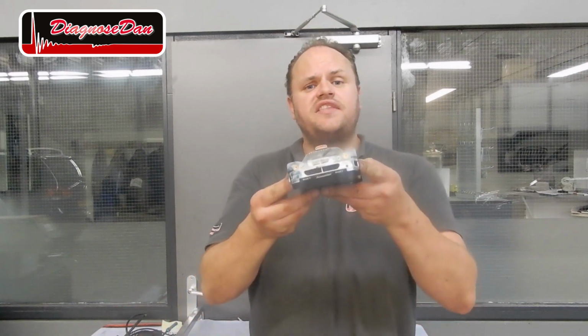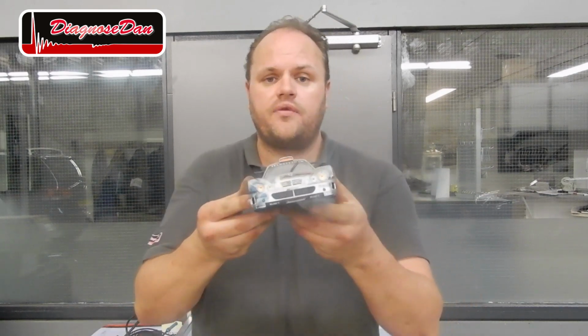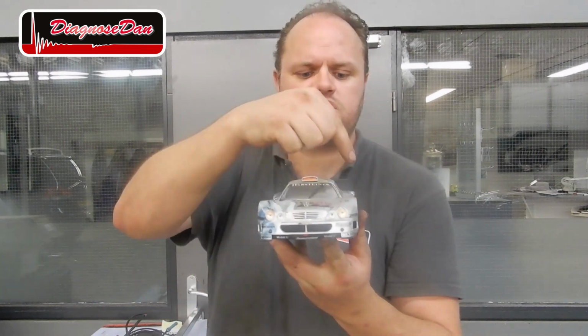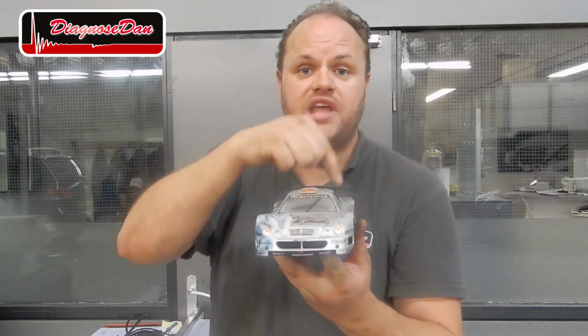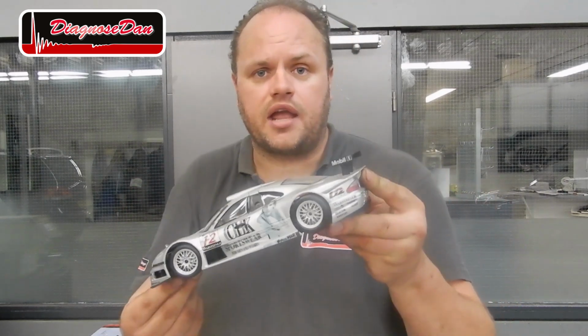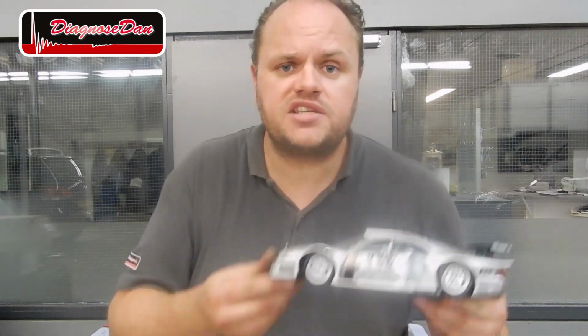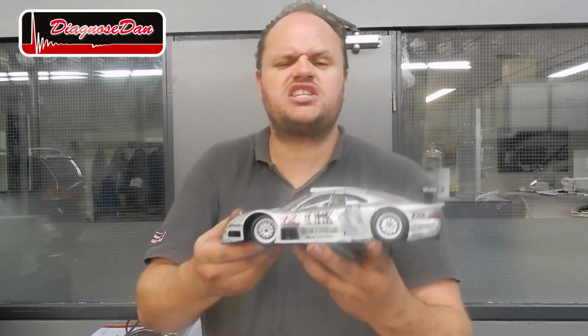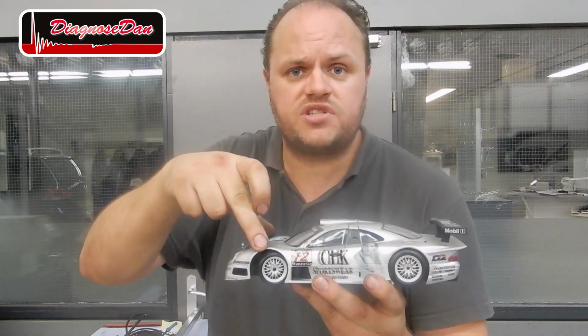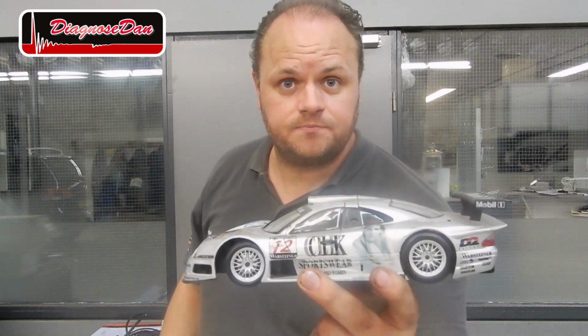The main VDM control unit is connected to a lot more sensors. For instance, the ride height sensors. These can detect when the car is in a corner, and the system can stop the car from rolling by altering the stiffness of each individual damper. The system can also detect if the car is braking. Now, normally when a car brakes, it nosedives. The system can detect this and stop this from happening by altering the resistance of the dampers.